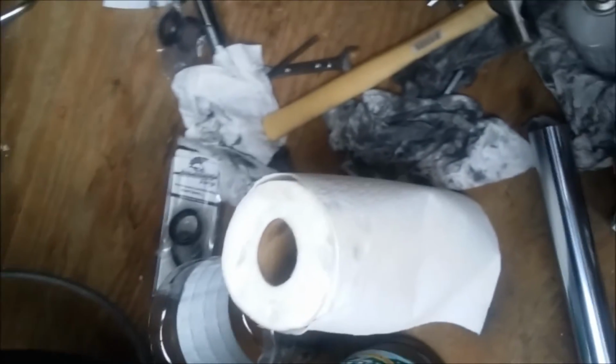So from there, it also makes it easier if you lube it a little bit. I use like some white lithium grease or something like that, or if your fork seal kit came with some fork seal grease, then you can use that. Also helps to slide it up and down the fork. So now you have your washer. It's going to sit down in the channel, and now you're ready to put your fork seal on.